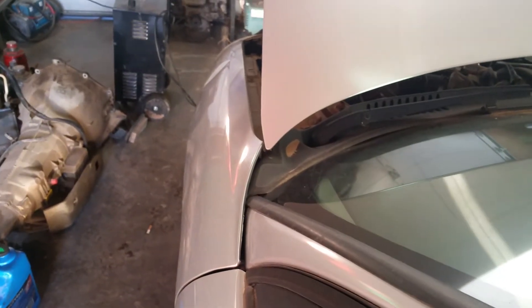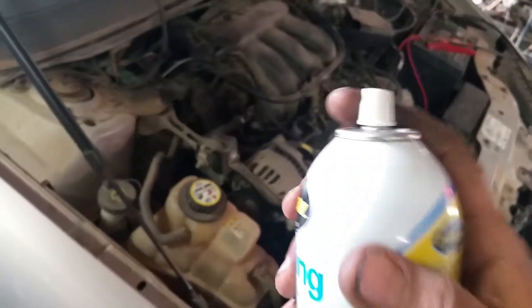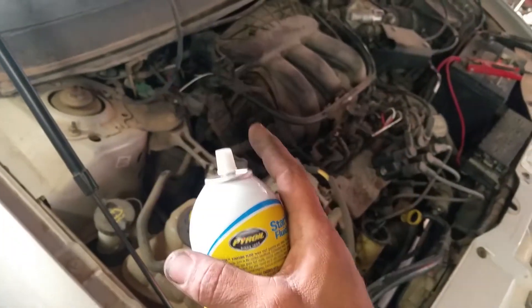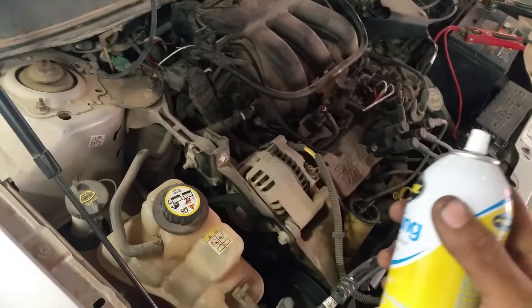So the next thing I want to test is a vacuum leak. I've got my O2 sensors put back in from the previous video. I'm going to go ahead and fire it up. Now we're going to check a vacuum leak. The easiest way to do that is grab yourself some starting fluid. Close the hood down to where you can barely see in there and it's dark, and make sure there's no sparks anywhere, because if it is a spark issue, you don't want to be spraying starting fluid. There are a couple other fluids you can use too — carburetor cleaner is probably better. It's not as explosive or easy to start under a spark, and it still does the same thing. Brake cleaner will do it as well. I use starting fluid because it comes up really quick.